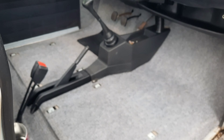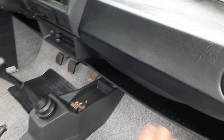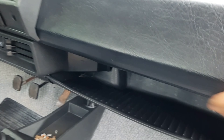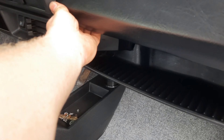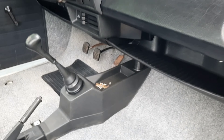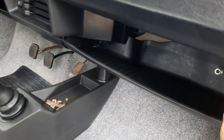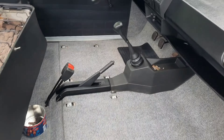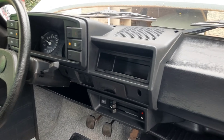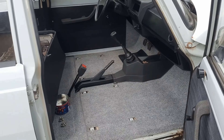The interior's looking a lot better. The carpet came up really well, the dashboard's gone back in. This is really annoying me because it keeps coming off — I recovered it and it's stuck everywhere apart from this bottom edge because it folds back and doubles back on itself. So I've bought some trim clips. They're for MGB seating and carpet trim — little metal spring clips that will actually clamp onto it and hold it along the edge, about half a dozen on each side. I decided for now to leave the radio out as it was when I got it because it's never had one. There's no holes for anything, so originality for now.